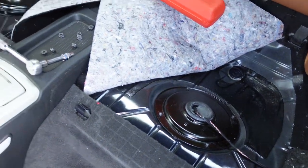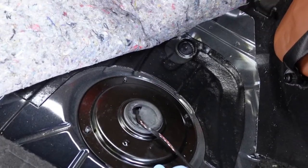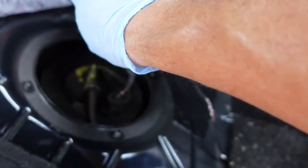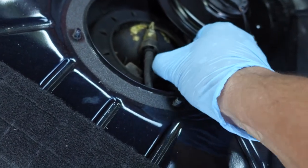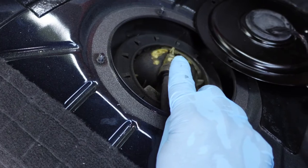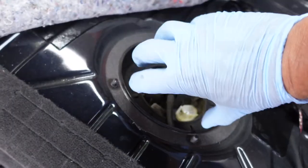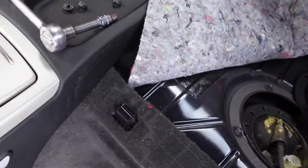On this side is the fuel pressure regulator; on that side we have the fuel pump — they both have to be disconnected. I've already loosened the four 10-millimeters around each side. I'm going to lift it up — trying to do this with one hand so I can hold the camera. Underneath we've got some connections to release. I can already smell the gasoline — yes, I've got gloves on of course. You can see I already opened this just to make sure the problem was what it is — it's gunky, it's wet, it's dirty. The smell is so strong coming out of there; I'm quite certain that's what's going on. Then we've got to unscrew the ring here that holds it down — there is a special tool you can rent from AutoZone. The rings have to be removed on both sides; they both have that hold-down ring.